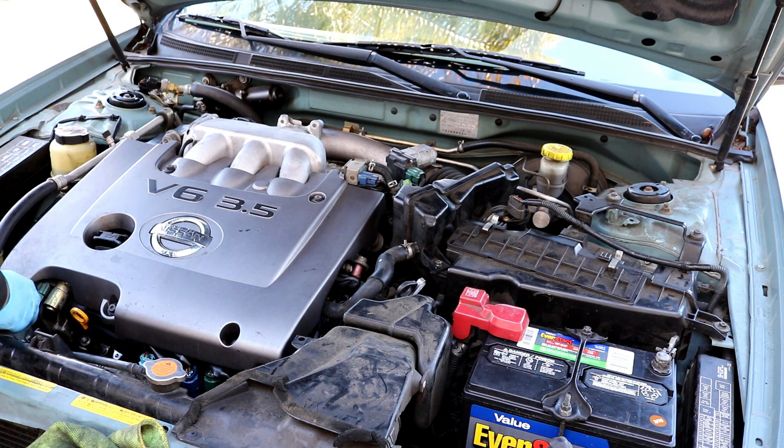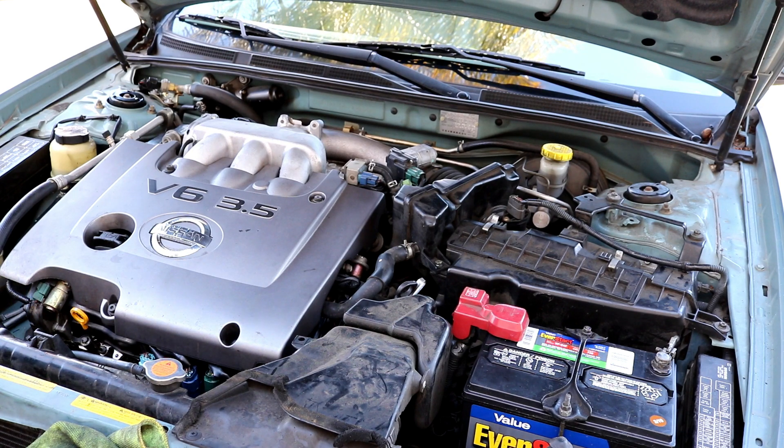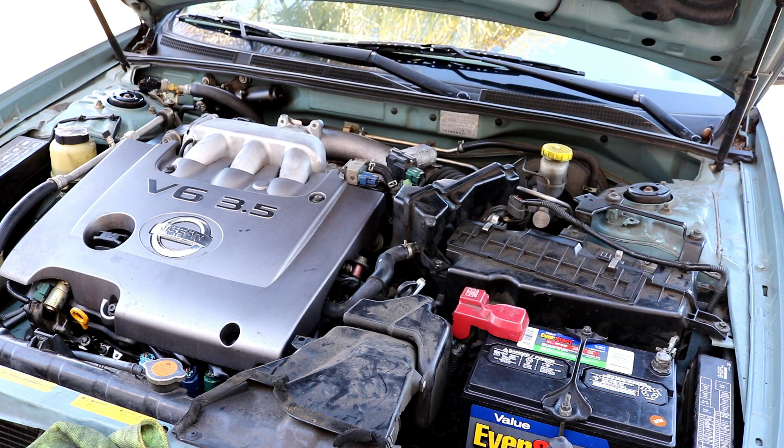Now we've got the intake box and everything back on. The last thing is the engine cover — just the five millimeter bolts. Two top bolts and two bottom bolts — try to get everything lined up, start them by hand, and the rest should line up easily. And that's all there is to it! If you have any questions, leave them in the comments. If it's your first time on the channel, thanks for stopping by — hit the like and subscribe buttons. I hope this helped. It was my first time on this engine and I didn't think it went so bad — most front-wheel-drive V6s are more difficult, but this one seemed less involved.